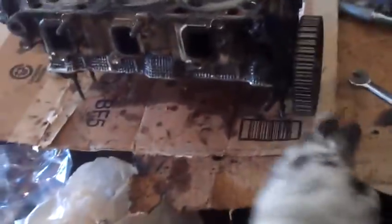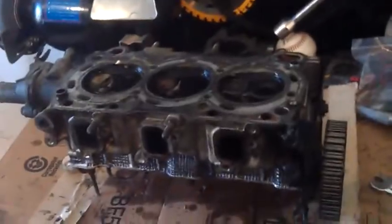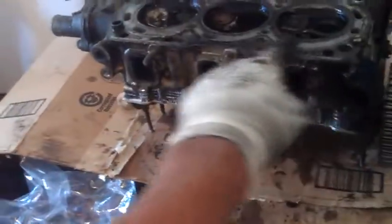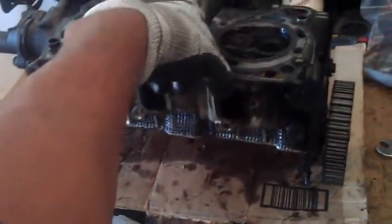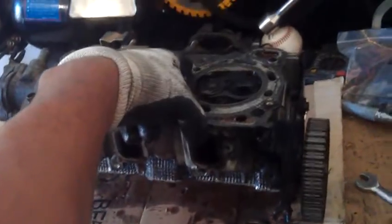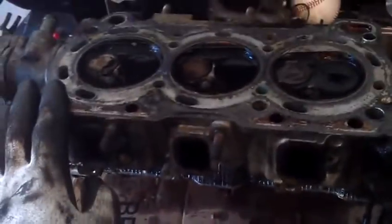For you guys out there that don't know how this all works, I'll make another video explaining how the valves work and what makes them open and close. My next task is going to be to go ahead and clean up the old gasket material on this head here as well as on the block, extract the bad exhaust valve, go ahead and reseat that, and I'll show you how to do that as well. I was thinking about doing all three exhaust valves, but there's no reason to because the other two are perfectly fine, so I figured maybe I'll just put some lapping compound down there and give it a light reseating.